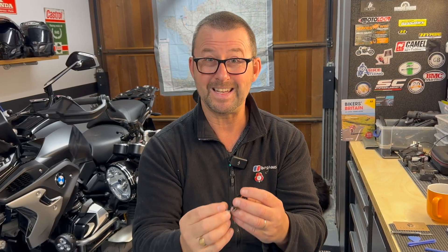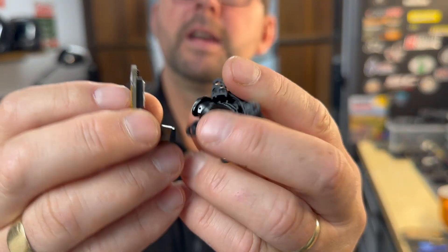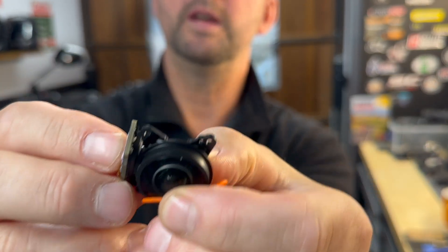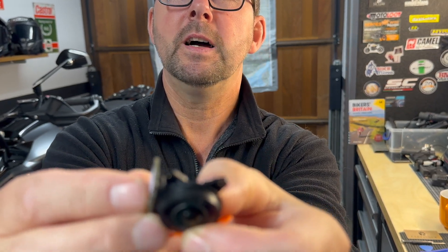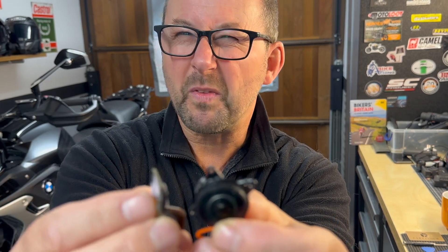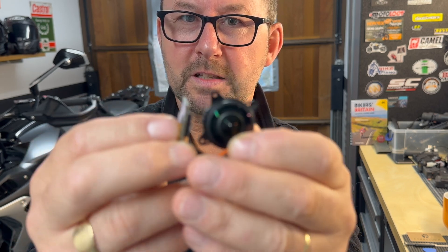You've got two sensors in the camera and there's a little joint on here. All that vibration when it's dragging along the ground just caused that joint to split, giving a different focal length. Because the focal length is different, you get blurriness of the image going onto the sensor, because the distance has changed — albeit very small.